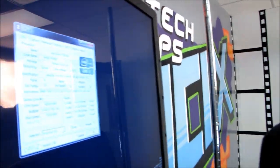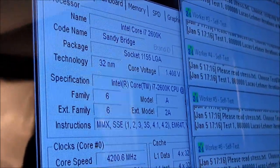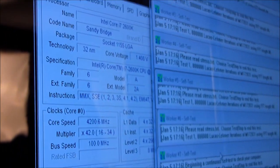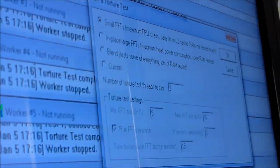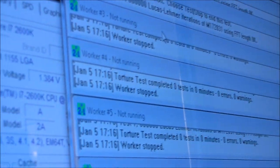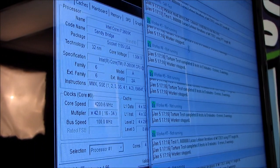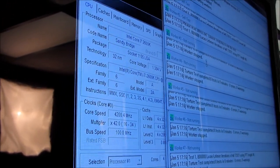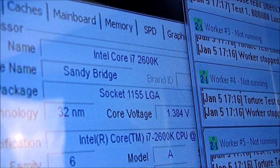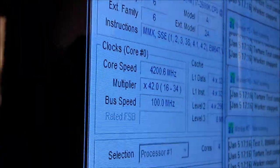Let's fire up CPU-Z and see if magically by rebooting once — it works now. So 4.2 GHz is what we're running at. We're stressing out four cores to the max with eight threads of Prime95, running two torture test threads of small FFT, to see if it's leaving Intel Turbo Boost enabled or going for a straight overclock. It looks like MSI has gone very conservatively here — they're actually giving it about as much voltage as I gave it to reach 4.7 GHz stable. But it's better to go conservative and assume that some chips won't overclock as well as others when you're doing a one-button overclocking method like this, versus taking it to the limits.